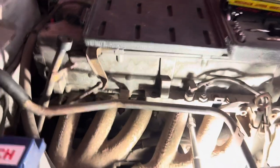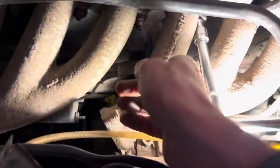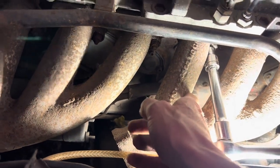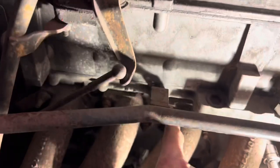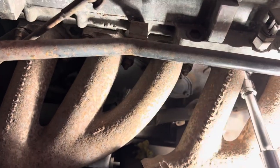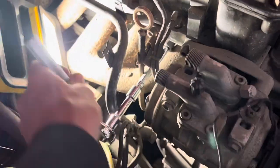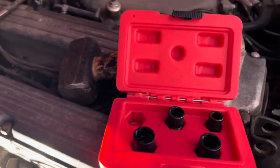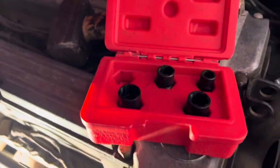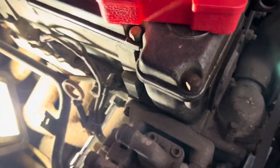In this video we're going to have a go at removing these manifolds here and getting them sandblasted and then painting them. I came here armed with an impact wrench and induction torch to undo those rusted nuts, but in actual fact every single one of them has come undone, which is almost a miracle. We've got all of these out apart from these last ones here where we've moved to the fluted Minotaur sockets that basically bite into the nut.